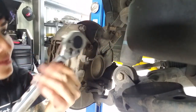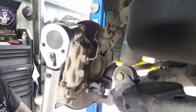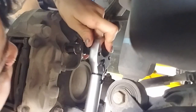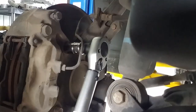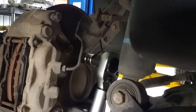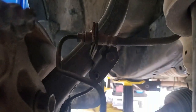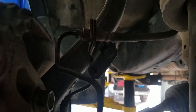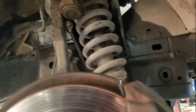90 foot-pounds. Tiny little extension for the other one - so small it's not gonna impede proper torque specification at all. And there we go, 90 foot-pounds. Got my 12mm bolt back in place, and got this little bracket holding my brake line back in place. Don't forget to remove your little hanger off your suspension piece, because that makes a funky noise if you don't. Ask me how I know.